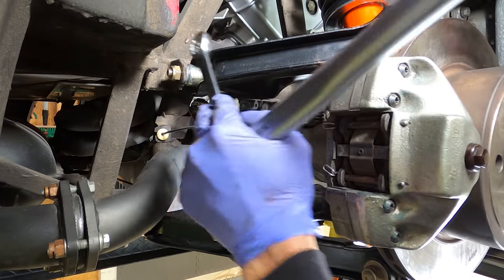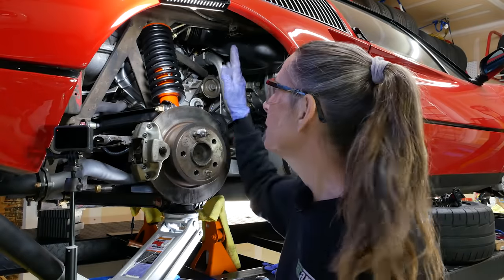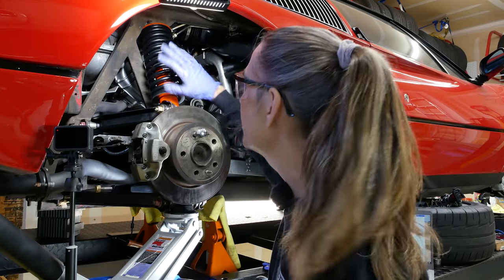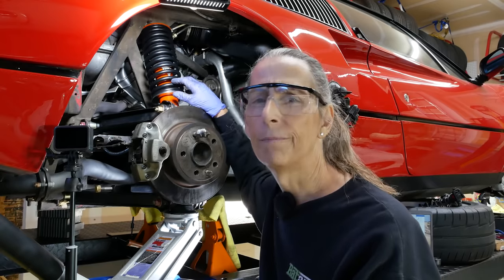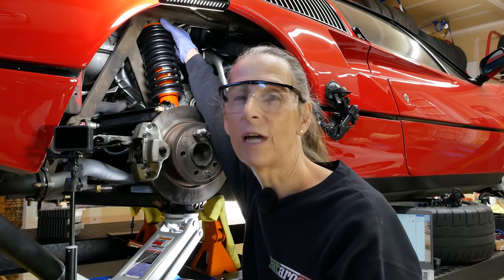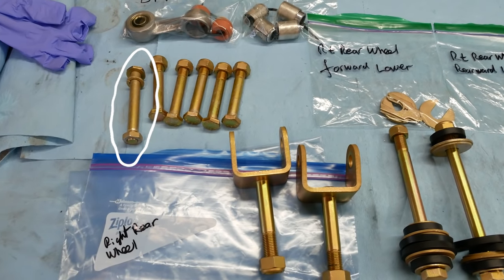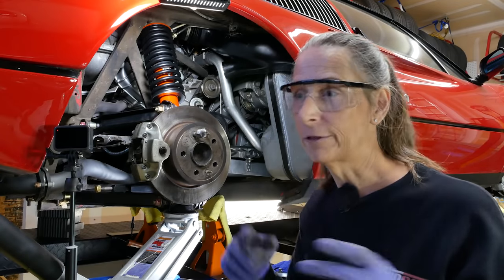Okay, that's that one. So this is really confusing to me. The spec says that for the bolt at the top where we're connecting the shock absorber to the chassis is only 20 foot-pounds. That's not a lot at all. The one down at the bottom here, because we have a cad-plated bolt, is 40 foot-pounds. So what do you do in these instances? I mean, this is a big bolt up here. This is a number 12 up here at the top. It's the same size as all the other bolts that we've been torquing to 50. The one that's actually connecting the shock to the wheel hub is supposed to be 40, and it's got a really, really teeny head on it. But all right, 40. Let's do that one first, because I'm pretty certain that one sounds reasonable.